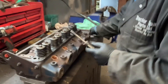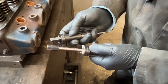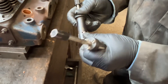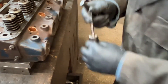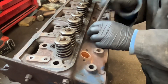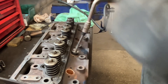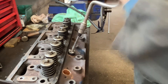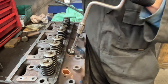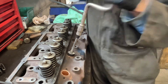What we have here are the two rolling tools used with injector sleeve 86K1098. These are old genuine tools — the company was originally Churchill and then it went to Wicksteed. You use the larger tool for the top. Put your tool in and it opens out and just expands the sleeve. What I've found over the years is that as it starts to expand it actually goes tight, and then you stop and back it off.